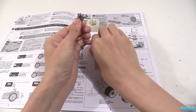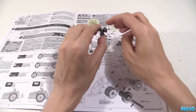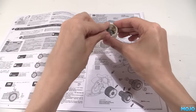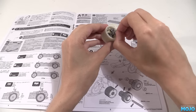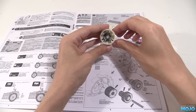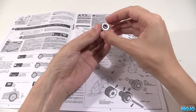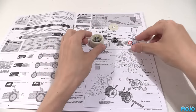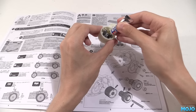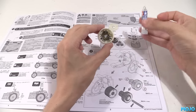Repeat for all three. It can be a bit tricky to keep hold of, so be careful. The assembly then drops into the main diff gear. There are three slots for the ends of the pins to slide into. It can be a bit of a pain to get it into position — a pair of tweezers could help if you're having trouble. Now the other side of the gear can get lubed up, the shim put in place and greased. With that ready, apply a liberal amount of grease to the inside of the diff over all the gears. Once the diff spins a few times, it will spread itself around.